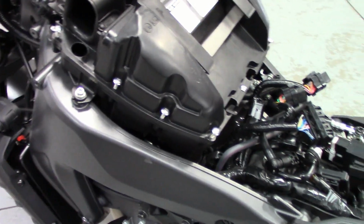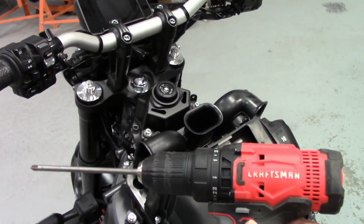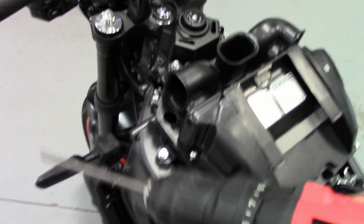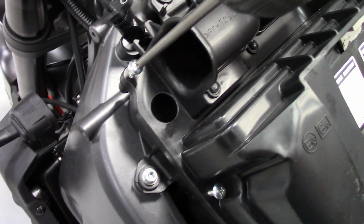Anyway, just a couple tips. So very carefully start all the screws, set them all in there. There's enough of a shoulder, they won't fall out. Again, I'm going to use my drill driver with the long, just a number two is fine. Turn the clutch way down to about 5 or 6 so you don't wreck anything. And then you can gently, let's see if I can do this, just a couple of them.